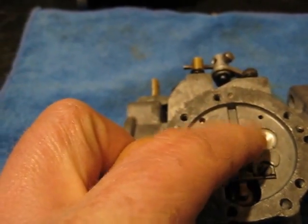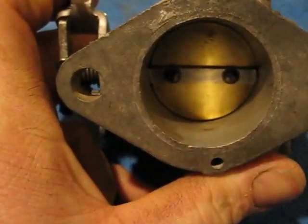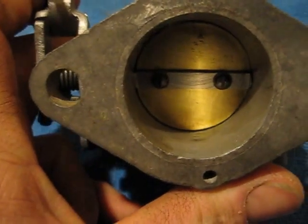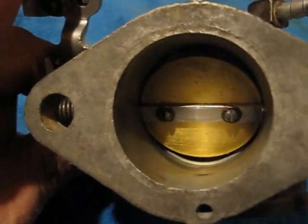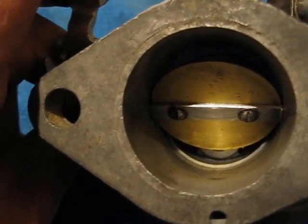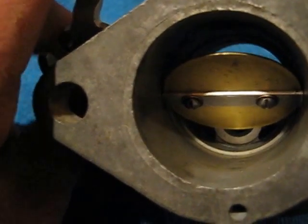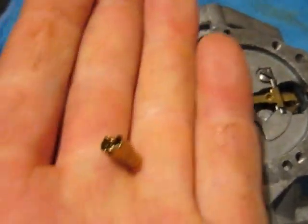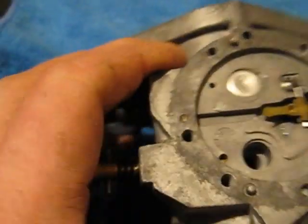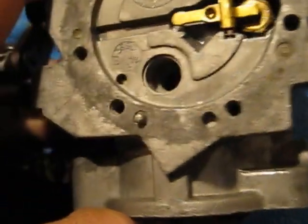Your low speed orifices sit behind the throttle plate — you can't see them in there but they're there. When you tip into the throttle it uncovers those orifices, and that's what makes the carburetor flow fuel. If you look down there, that's the venturi — the circular thing. The high-speed check valve sits inside there. The air accelerating over the venturi excites the ball, it loses the seal, and then the fuel flows.